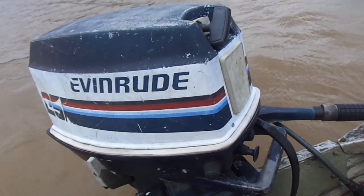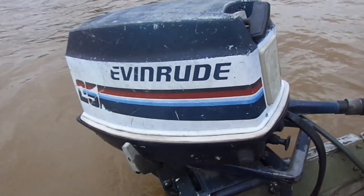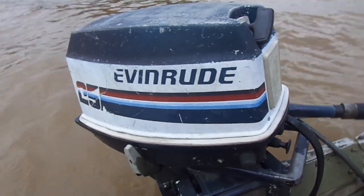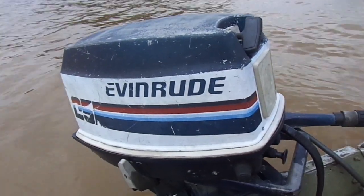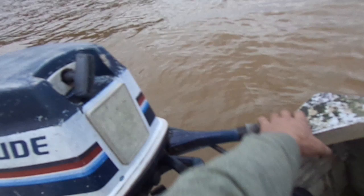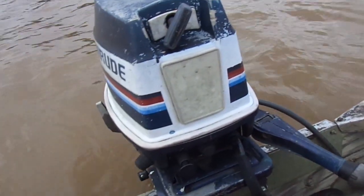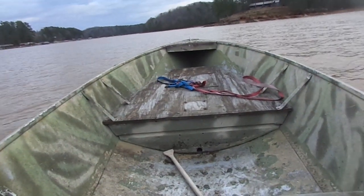February 17, 2018, Lake Alatuna. You are looking at the early 80s Evinrude 35 horsepower motor with a 25 horsepower cowling on it. It is a short shaft pull and electric start tiller. Just cleaned the carburetors on it. Motor has 125 psi in both cylinders and it doesn't look like it has ever been rebuilt. It will be tested on a 14-foot boat.